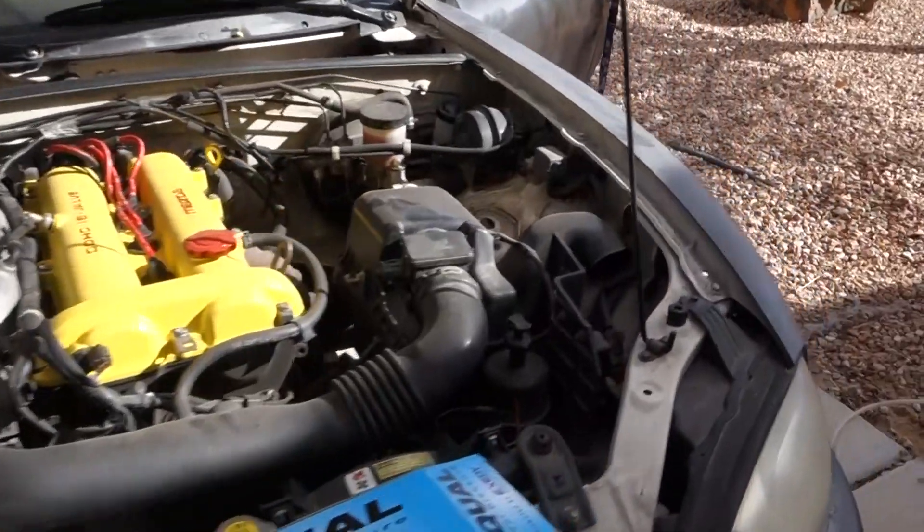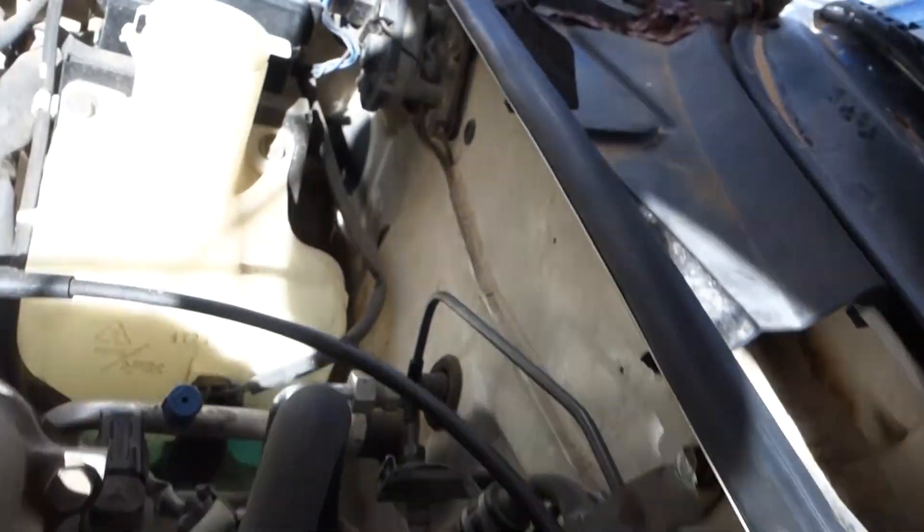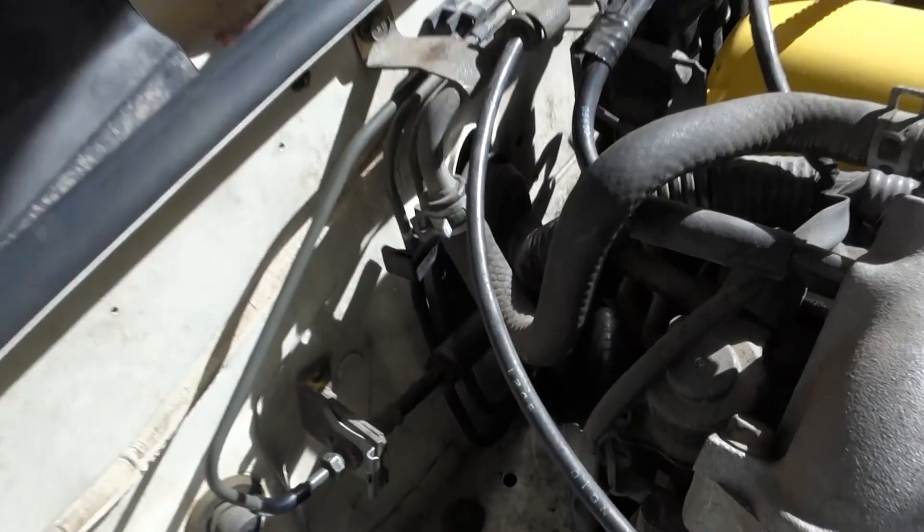The line check came out good. We put everything back on - the line is back on and the new clutch reservoir piece is back on. You can see how the line connects from right here and goes back over to there. Now we're going to do a little test. We're going to fill it up with brake fluid, do a couple of pumps, and bleed it to make sure there's no extra air in the hose or line system.